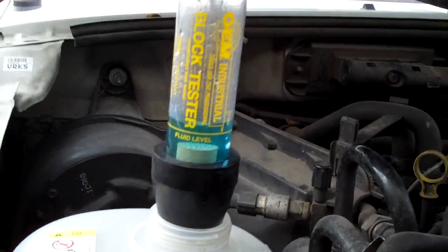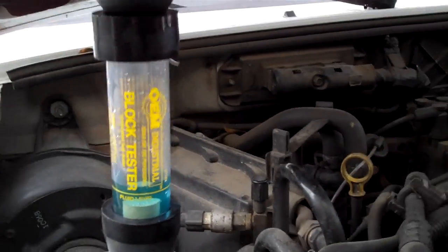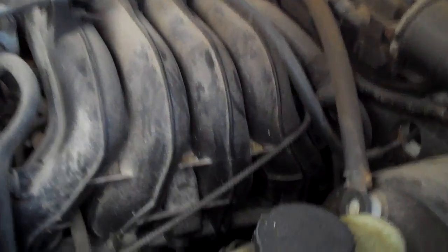The dealership diagnosis is a failed head gasket, but I'm saying it's not. If you look at the fluid, it's just as blue as it ever was — there is no hint of yellow whatsoever. The interesting thing is this is the same dealership I used to work at. They want to do the head gasket on this because it's a lot easier with the head off to replace that pipe, and the teardown time gives them labor hours.